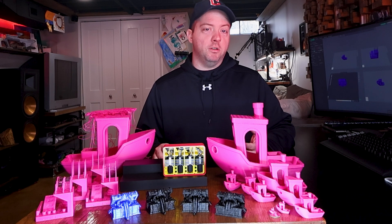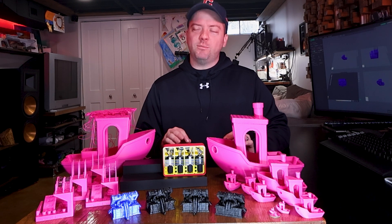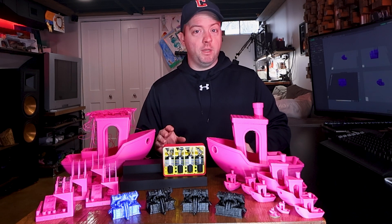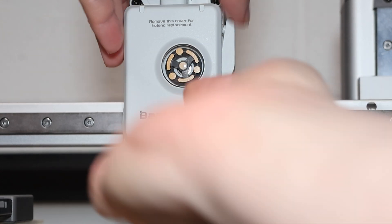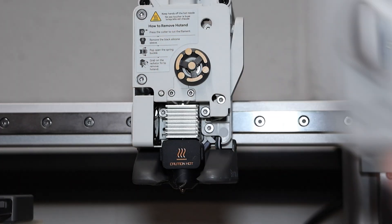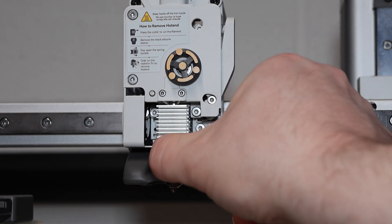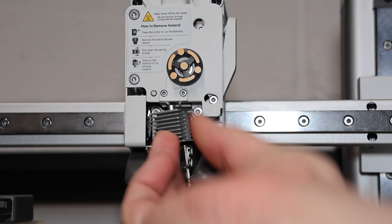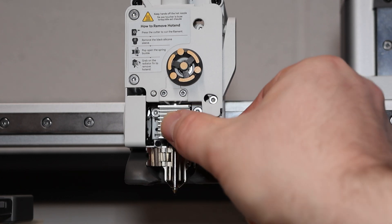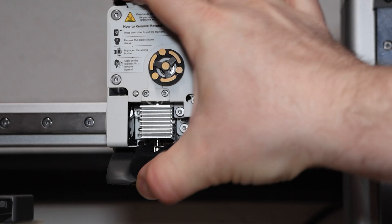You might be here because you just bought a new nozzle, so let's look at how to change these on both the A series and the P/X series. The A series is completely tool-less. First, heat the nozzle and retract the filament. Once cooled, pull on the front cover from the bottom — it's held on with plastic clips so it'll pop off, probably violently. Remove the silicone sock on the nozzle and pull away the two-part latch. The nozzle is held in magnetically, so simply pull it out. Put your new nozzle in and reverse the process to reinstall. When installing the front cover, it hangs on the top, so push on the bottom half.